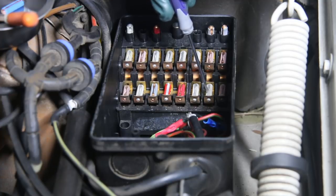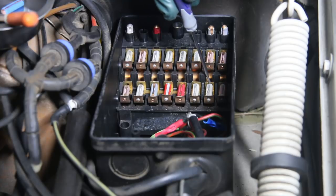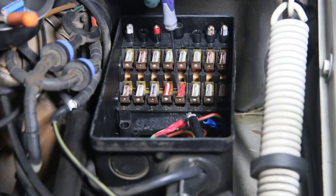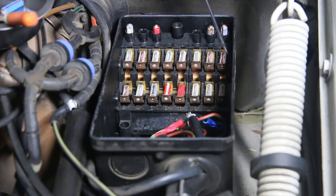Sometimes a warped fuse means it has been overheated, and when they overheat the corrosion increases on the tips. I'm going to pull this fuse out. In fact, over half of these are the old aluminum type fuses, with just a couple of copper brass alloy replacements. I'm going to pull out my fuse kit and my special tool, and while I'm working on number 14, I'm just going to replace all these fuses. This is one of the best electrical preventative measures you can do on these older Mercedes-Benz.